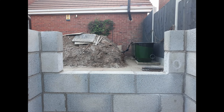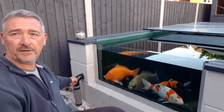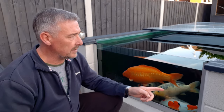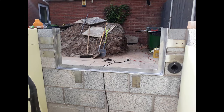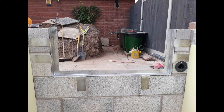The little round circle thing you can see on the right hand side of the picture is for the inlet. I got a local fabricator to make my frame — it's a 5mm thick, two inch by two inch angle frame. I put it in the hole and you need to get it fiberglassed over the top of that. Some six millimeter raw plugs and screws found in the garage held it in place. Once your frame is in, I also put in the insulation at this stage because the frame has to go in before your fiberglassing.